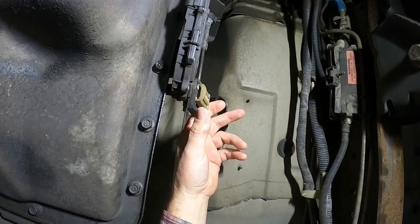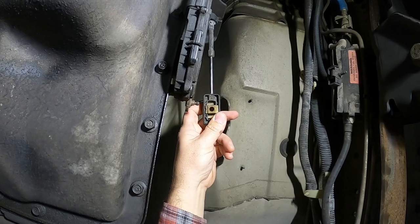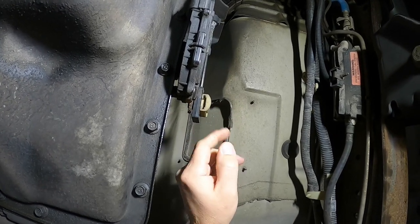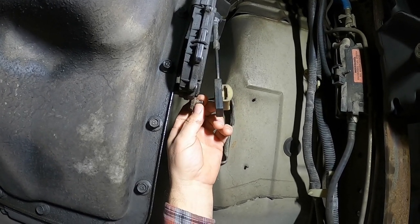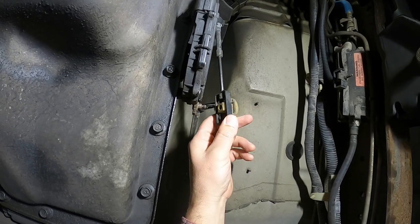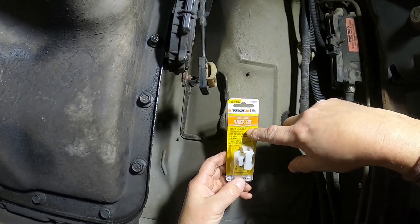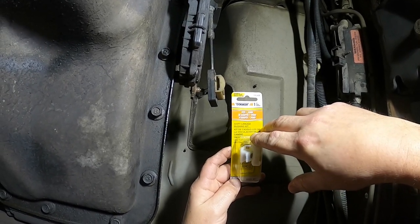Please subscribe, thanks for watching, let's get started. As you can see, this piece that goes on the transmission — the one that actually puts it in gear — it came off. The guts inside are missing, no doubt because it's plastic. We're going to replace this piece because there's nothing left inside to grab that little knob. The part is a Dorman 14908 and you can get it at O'Reilly's, AutoZone, or somewhere like that.